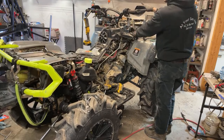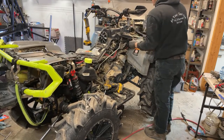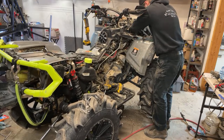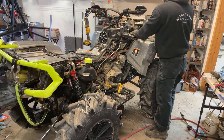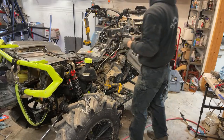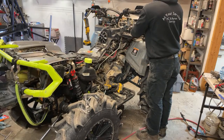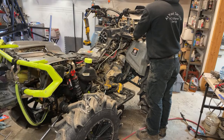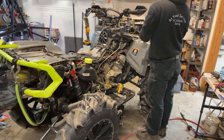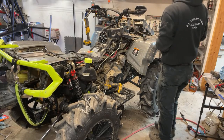My lifter, actually, if you're still there, this ECU is tuned by RVS, I believe is the company name. He already had a tune on this. I was able to find it out because on the ECU itself there's a tag that says stage 2, which is fun enough with the exhaust, and it's basically a simple tune, nothing crazy. They do raise rev limiters, which is nice, and delete any torque limiters, and all that fun stuff. So far it does feel like a pretty good tune. We're gonna have to find out as time goes on.